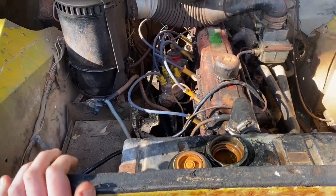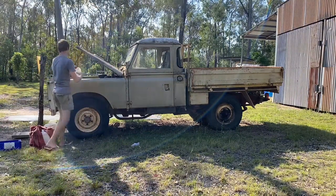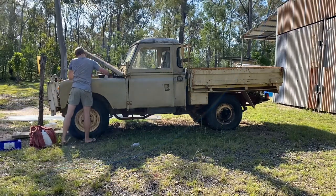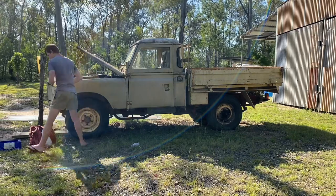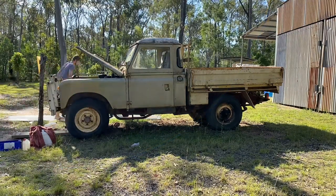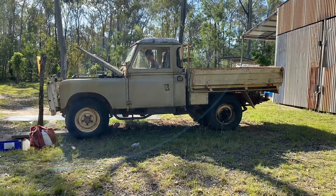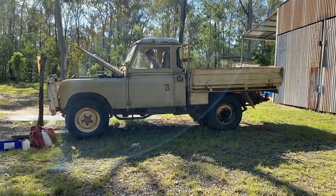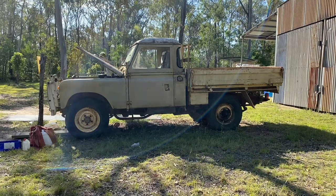Moment of truth — I'll see if Murphy's Law doesn't come in this time. I've got it all full of water with a little bit of coolant in it. I did get new gaskets on the thermostat housing, all sealed up with sealant — that seal worked pretty good. I'm not going to say much though because knowing my luck it might probably leak again. I'll pop a battery in and we'll see if she goes. I'm hoping the needle and seat doesn't stick again — it would be too good if it did.